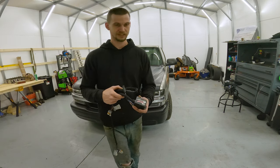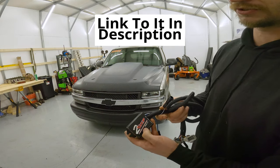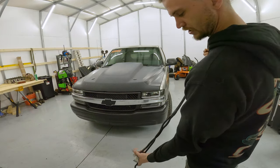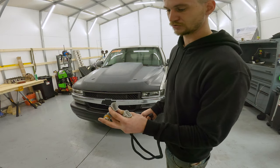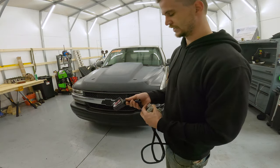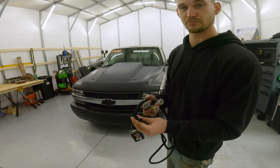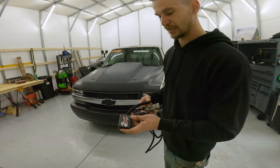So this is what you get — it's made by MSD Ignition. It's a two-step LS series launch control. That's the part number right there if you want to pick one up. It's a pretty much plug-and-play setup. You're going to have these two connectors that go to your coils, in between your coils and your engine harness. The only wire you'll have to run is a feed from your brake pedal so it knows when you're on the brake.